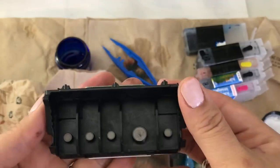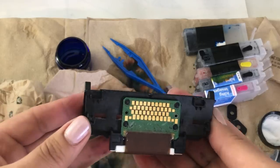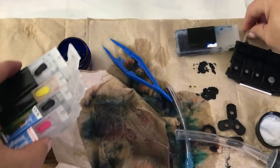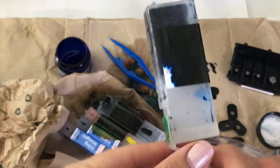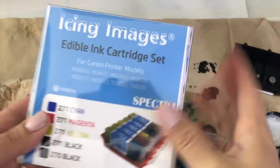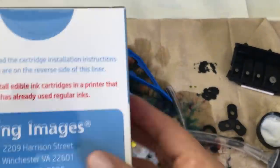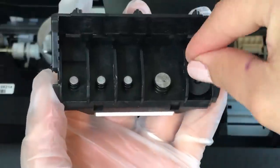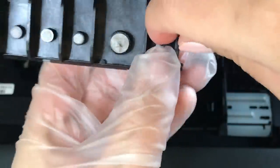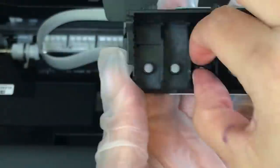Here's also a look at my clean printhead. Since my ink cartridges did empty out and I don't have the orange clips to refill them, I will be using new ink cartridges and will be saving the orange clips so that I can do refills in the future. Now we are going to place the bands back into our printhead — make sure that the ridges are face side down and do that for every single one of those slots and bands.